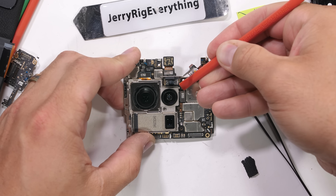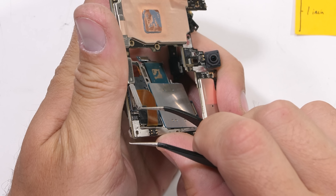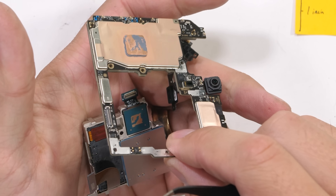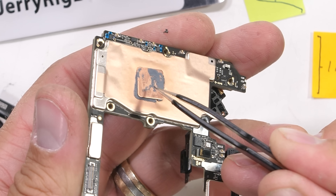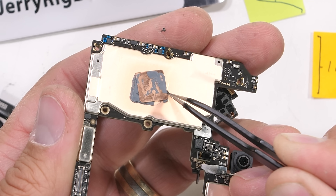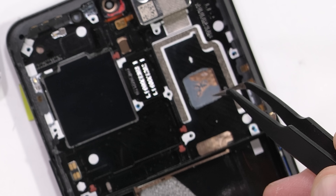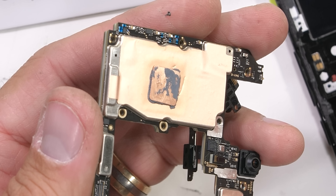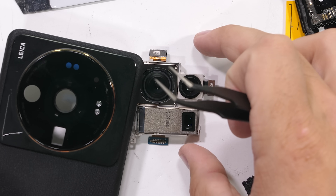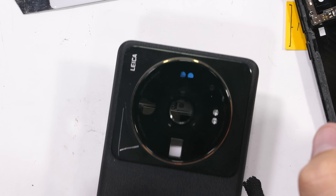Removing the three camera modules from the motherboard is simple enough. There are three Lego-style ribbon cables — two on the front of the motherboard and the third wrapped around back, pinched down underneath the metal bracket. It's interesting back here as well that the processor actually has thermal paste and then another copper plate that sits down inside a little square to help with heat dissipation — we don't think we've ever seen a little copper extender unit like this. These three camera units are all bound securely together inside a metal housing, which keeps all three positioned correctly and working together as one.